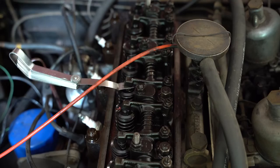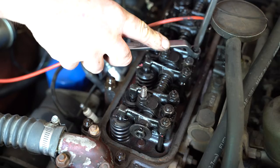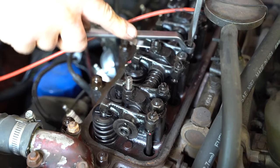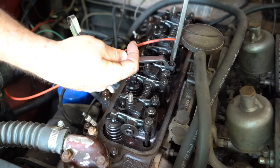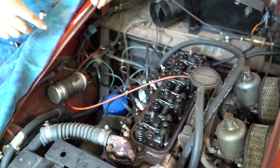You know, when we had Kent Prather on talking about building B-series engines that'll turn 8,000-9,000 RPM, the takeaway from his talk, much of which escaped me about balance, was consistency, and that the valve lash is exactly the same, and the valve height is exactly the same. It goes on and on and on. That's it. That's all there is to adjusting the valves.